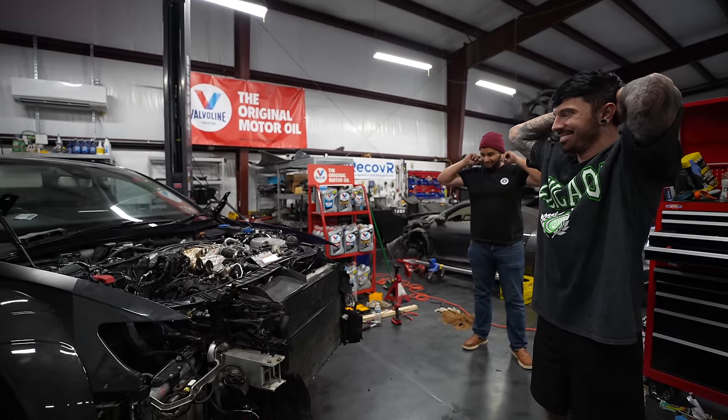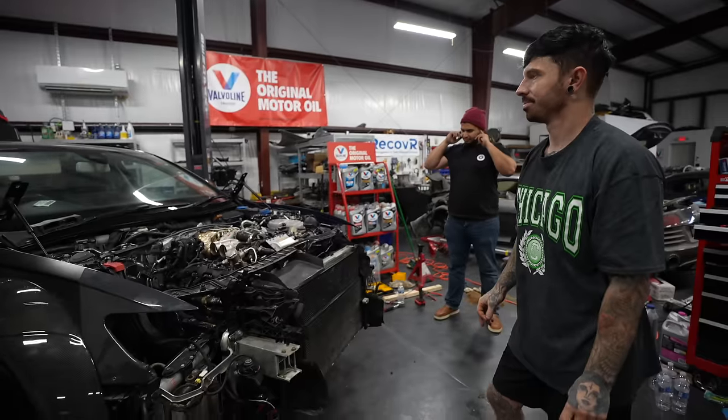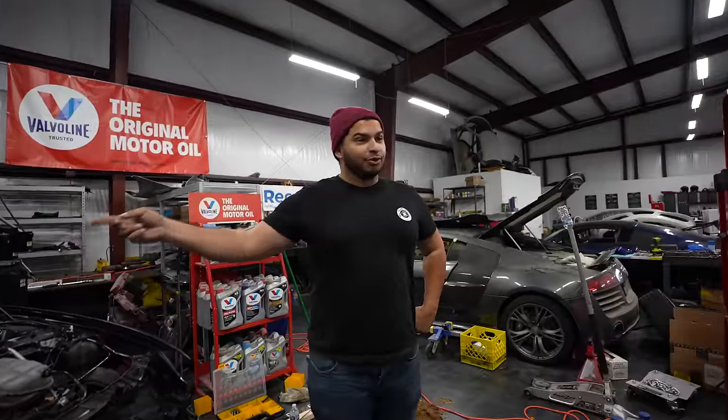No. He stabbed the brake and then hit the start. But it didn't seem to be turning over. Okay, maybe we need to put the code reader in and clear the codes. Because if the starter motor turned last time and it was seized, maybe there's some kind of safety thing stopping it. I know there's a pyro fuse underneath the dash.